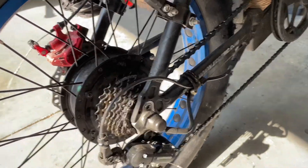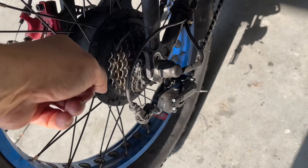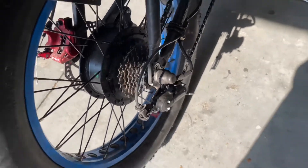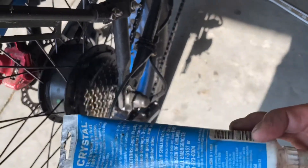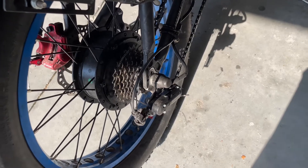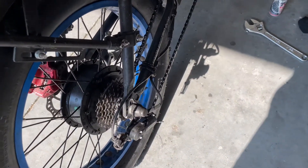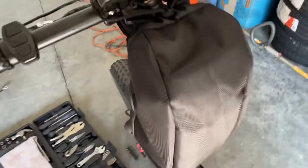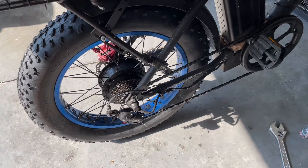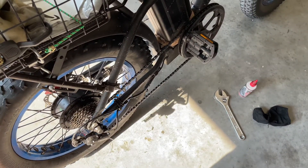That is basically how you take care of and grease the hub motor. Take out the six T20 screws, pop it open, and lube the planetary gear with bike grease — basically all the plastic planetary gear inside. Grease it and you're gonna have a quiet hub. It should last a long time. I'd say do it maybe every two thousand miles — I've got 2,399 miles on this one, first time greasing it since it was brand new, over a year old. Now it runs smooth. All right guys, signing off until next video — take care, any questions or comments just leave them down below. Bye bye!